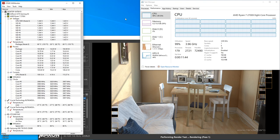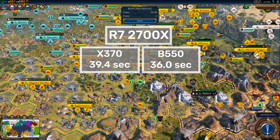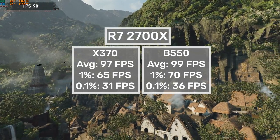And it was a similar story when I switched over to the 2700X. My X370 seems to simply not be able to provide as much power to the chip as the TUF Gaming B550+, which resulted in a max stable overclock on X370 of 4GHz all-core, while I was able to get it to 4.15GHz on B550. With that and the memory config from our previous tests — 2800MHz on X370 and 3200MHz on B550 — I fired up the benchmarks again, and this time the B550 decisively outperforms the X370. In Cinebench, the X370 config managed an all-core score of 3812 and a single-core score of 396, while the B550 config ramps things up to 4016 all-core and 420 single-core. In Civilization VI, turn time on the X370 averaged 39.4 seconds and 36 seconds on B550. Then in Shadow of the Tomb Raider, the X370 config averaged 97FPS, while the B550 config just misses out on 100FPS with even more solid lows.